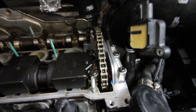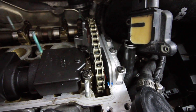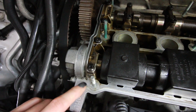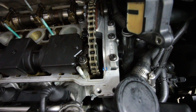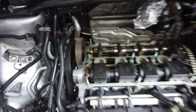This really is not that difficult of a job. The cam chain tensioner did come with a gasket that has some blue RTV-type stuff on there — it probably gets sticky with heat. But I also included a tiny film of the Right Stuff sealant, a super super thin coating, just in case. All I have left to do now is put my new valve cover gasket on and apply a thin bead of RTV at the corners and bends in the gasket surface.